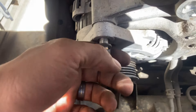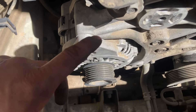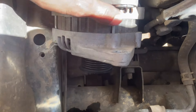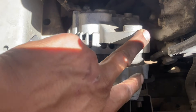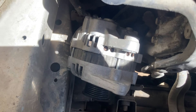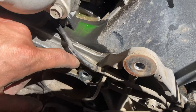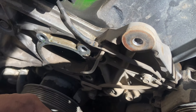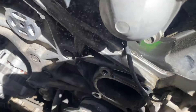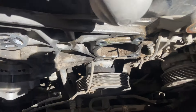When you get the two bolts on the alternator undone, be careful taking it off not to damage the pulley — that'll really shorten the life of the alternator. There's also a plug and a main lead wire coming off the back, so for this job I'm just going to leave the alternator down here rather than remove it all the way. Over here you have your crankshaft sensor wire — it's going to be really important to remember where it goes because when you install it, you want it on the outside of the accessory plate. The rest of the accessory drive bolts are a combination of 14s and 17s.